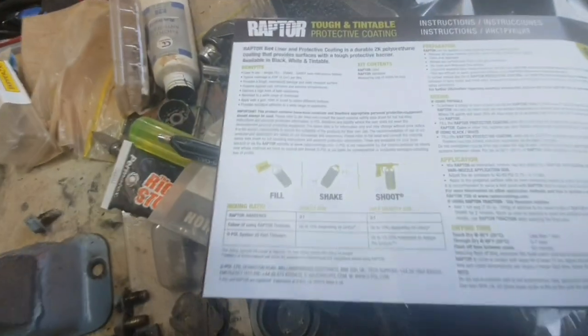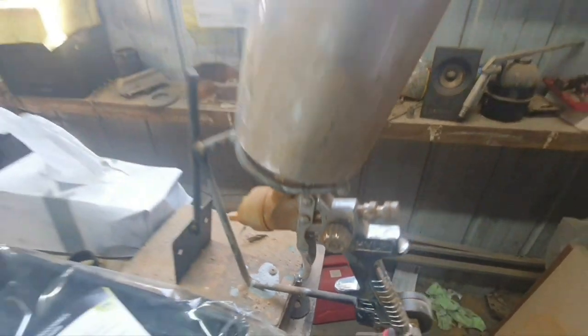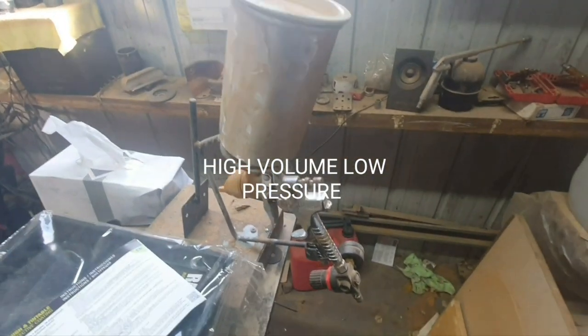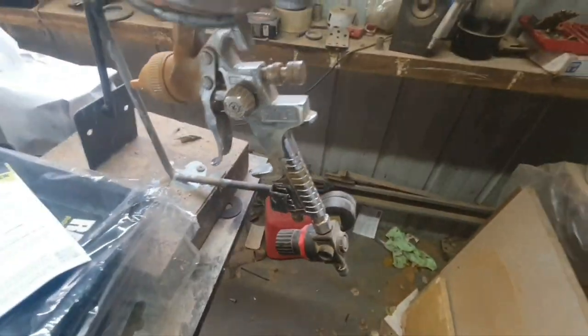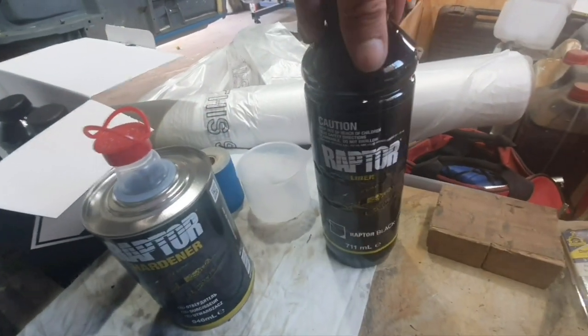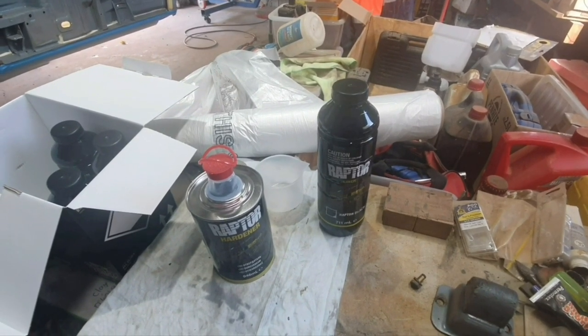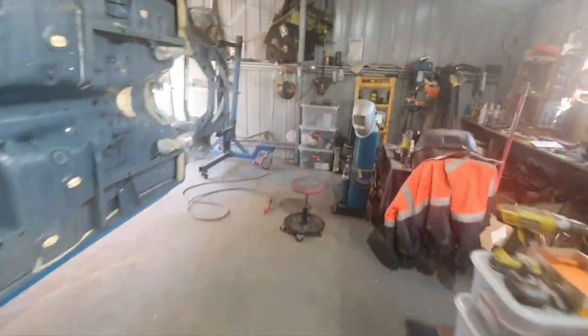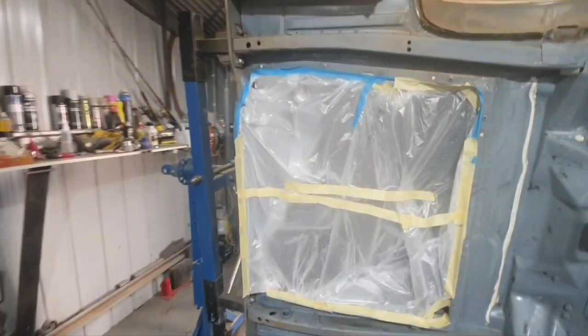They've got a mixture guide here — if you use this type of spray gun, a gravity feed gun with a 2.5 fluid tip, I shouldn't have to thin it too much, this will just flow it on really well. It's got its own little regulator. Cheap as chips but it does the job. Got the Raptor ready — I've got plenty, I think I'll probably do two bottles. I'll give it a coat now, give it another coat, maybe another coat later. The weather's bloody brilliant — humidity's dropped right off, temperature's great. You just don't know with the weather, it just chops and changes all the time, so you've got to take the opportunity. When all the conditions are right, get into it.